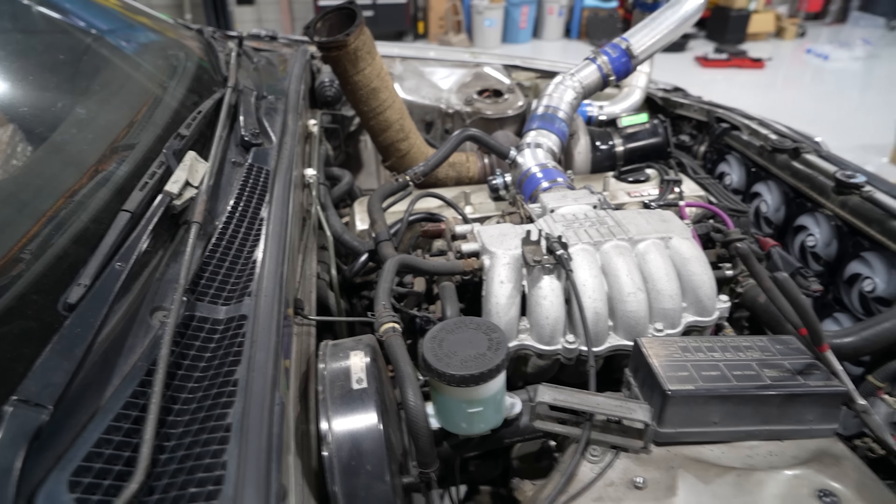Let's see if it'll run again - starts first thing, no problem. The clutch sounds so good. No problem at all - I think that starter is good. For those wondering, you do need to connect these two wires together. I'm going to check if the harness I ordered from Wiring Specialties actually comes with something that plugs into that - there's a high chance it does, and that way I don't have to cut, join, or do anything there. But we're mint, I think we're good.